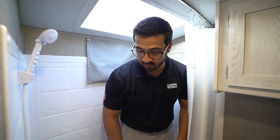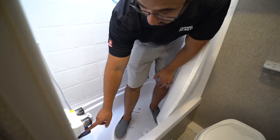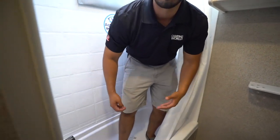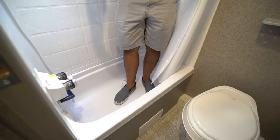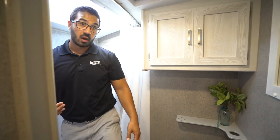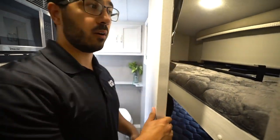There's a hand wand here to make showering easier. And this has the shower miser system — basically it's a little recirculation line. You see a little blue elbow right there. As you're waiting for your water to heat up, this will just recirculate back into your fresh tank, so that way you're not wasting a bunch of water going into the gray tank like it normally would. As soon as it turns white, it's hot — you can flip the lever and the water will come out of the shower head. If you're doing a lot of boondocking, it just saves you on a lot of your fresh water.